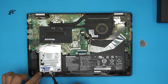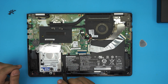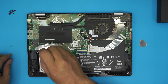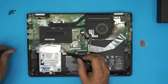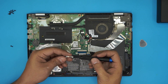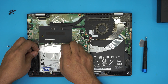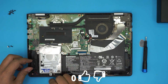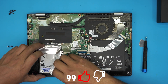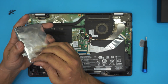Right here is your mechanical hard drive. To replace it, you need to remove three screws: one is right here at the back, one right on the side, and one is right on this warranty label — you can remove the label or just stick the screwdriver right through it. Once you've got those removed, all you need to do is pull the hard drive back toward the front end of the laptop and then lift it up.